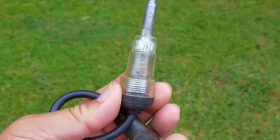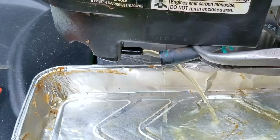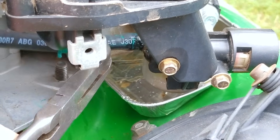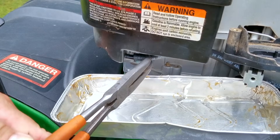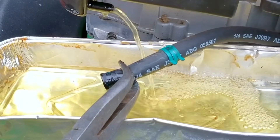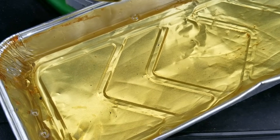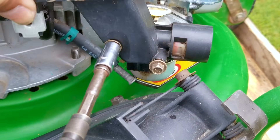Because it started and ran, it also means that we have plenty of spark from the ignition system, so we don't need to use the spark checker either. I do want to see if there might be a clog in the fuel line that's preventing fuel from leaving the tank, but as you can see, there is no issue with fuel flowing through either end of the fuel line. Although it doesn't happen all that often, there is a chance that the fuel line could collapse, causing a blockage. I want to see if there might be something wrong with the fuel in the tank, so I'll drain it from the bottom. From my first impressions, the fuel still smells like gasoline, and even though it's a bit darker than I'd like, it should still burn just fine. Since the gasoline, fuel line, and gas cap all seem to be in working condition, that pretty much leaves us with the carb as the likely problem — shocking, I know. But we had to do all our testing to make sure it wasn't something else causing our problem.